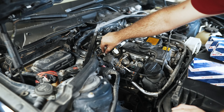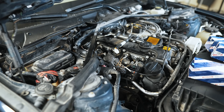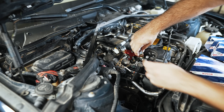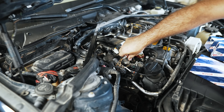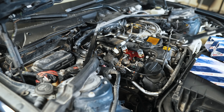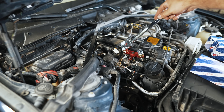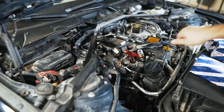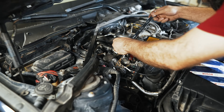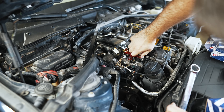It's a good opportunity to disconnect the injectors — I'm putting a pick tool on the side and then pulling straight up. We can get all this wiring right out of the way. We'll take this 10mm stud out. Take these out — they seem like they only go one way. But if you see the other side, it looks like green side down; there's a little dot. Now I'm bringing over this tool — it's got little spacers that you'll need to put in place first, then get these threaded on. Those threaded in smoothly — that's a good sign. Most of you won't have a 24mm wrench; I bought it because it's come up a few times. You could use an adjustable wrench. Because they're reverse threaded, they'll draw the injector up. That popped free. Pretty abrupt, actually.